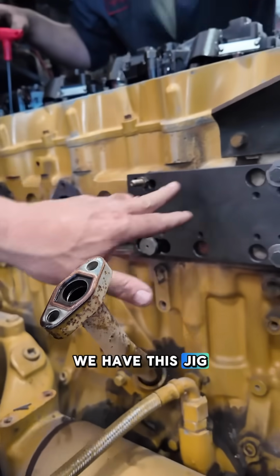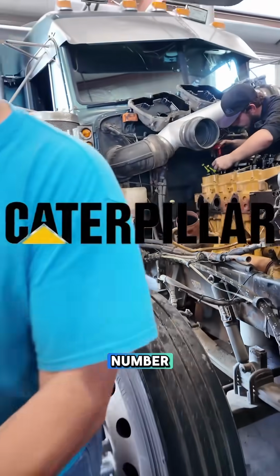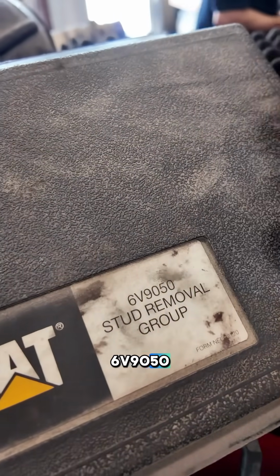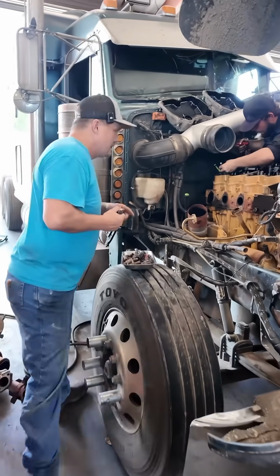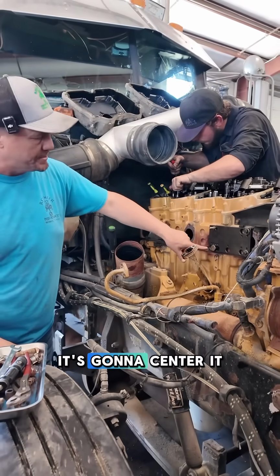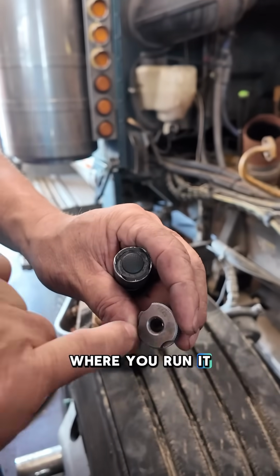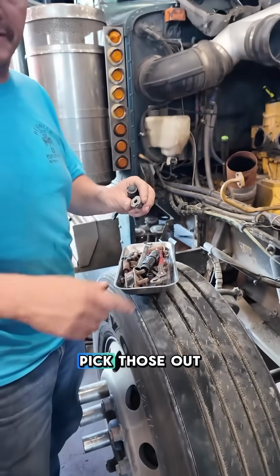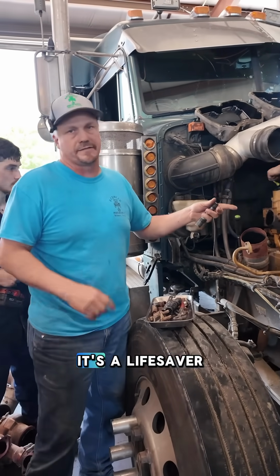We have this jig, and it's actually a Caterpillar part number. You see here a 6V9050 that sets it up to where once you put this on here and you punch that hole, it's going to center it perfectly. It has another bit in it where you run it down the hole, and the only thing you've got left in there is threads, and you just kind of seal pick those out. Other mechanics I know follow me and whatnot. If you don't have that kit, it's a lifesaver, guys.